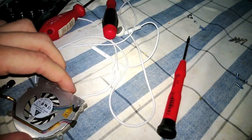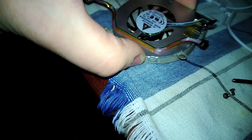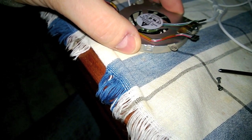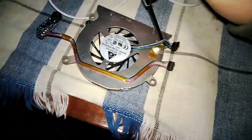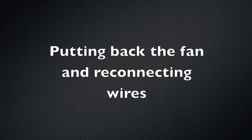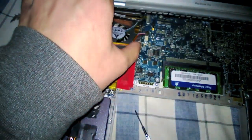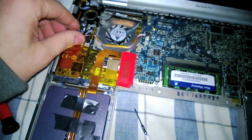The reassembly process is fairly simple. I just wanted to point out a particular aspect: align that notch with the bracket on the metal part — you see? Now reassembling the fan to the shroud is very easy, just bolt on those two black bolts. Slide the fan carefully back into its place, being careful not to apply force to any of the wires.